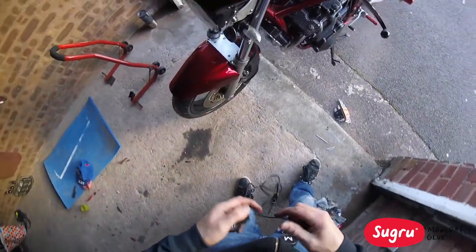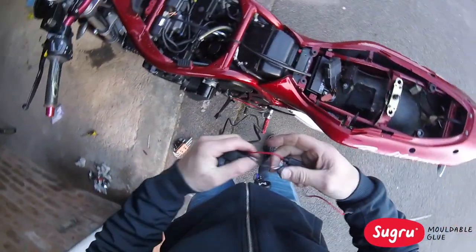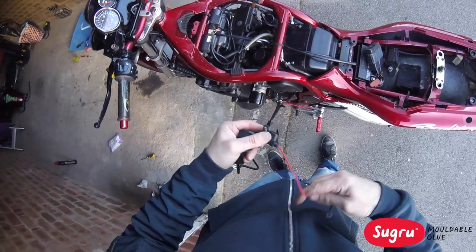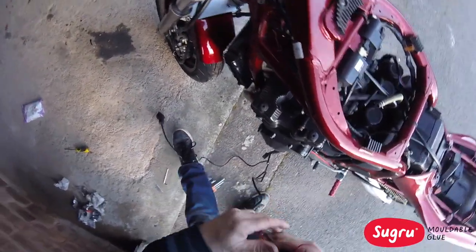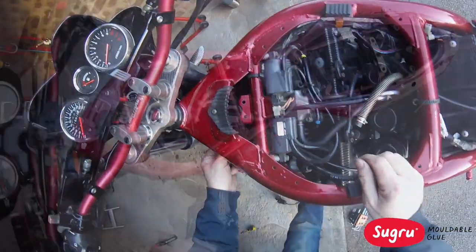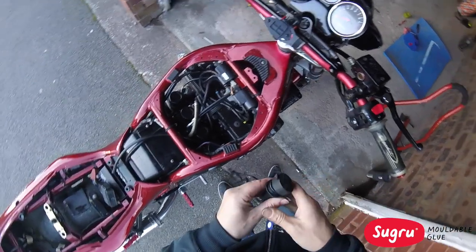What I'm going to try and do today is fit a USB charger. Never got any power being an old bike, so I'm going to try and wire one up myself. It's an inline one with a fuse on it — I'll be taking the fuse out as you can see here. I'm just going to thread it through, then find out where to mount it. I've took a few bits off — tank off, seat off — so it's the best time to access it. That side is better because my heated grips are going on there soon.